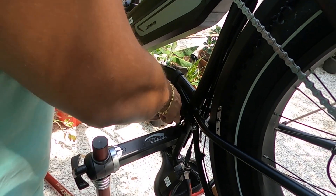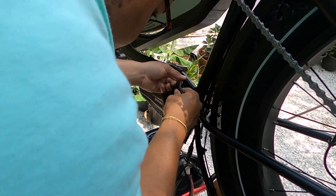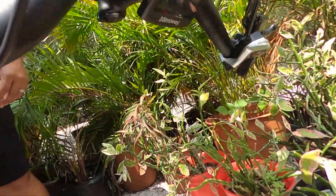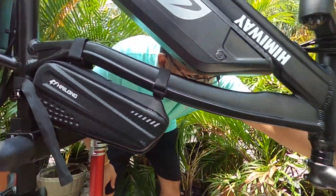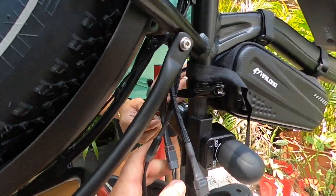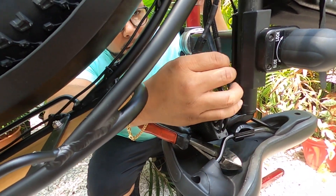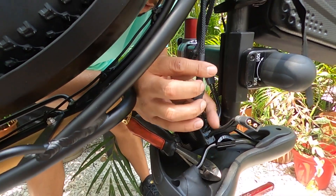All right, we're off. If you need to unzip it you can, but just be mindful that the battery doesn't fall out. Just plug that in. Perfect — try the same thing. I'm going to go ahead and turn it on. There we go, live! Twist that throttle. Perfect. So now we know that the second recommended battery strapped to the frame is the one powering it. This one is your factory battery — go ahead and plug that into the balancer, and be mindful of how the wires run up and down the seat post. Make them straight, just make it look clean.